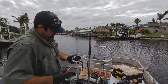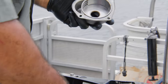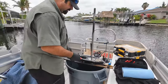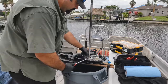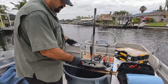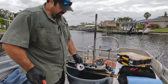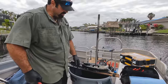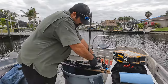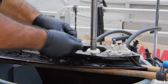There's your impeller, and everything looks really good, so we won't have to do an entire impeller replacement — we're just going to do an impeller kit. Some kits come with the housing and the bearing carrier seals, but everything looks good here. There's no oil showing, and the gear lube was nice and black with no condensation, so for this particular setup it's all in good shape.